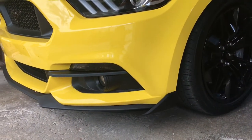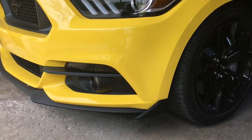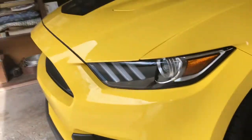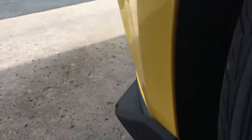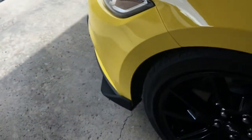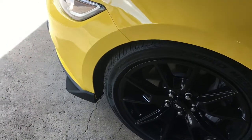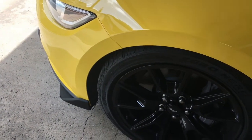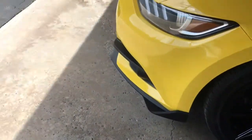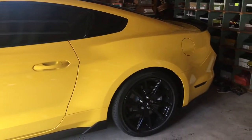The installation was not bad at all. The fog light splitters were probably the most amount of work, but even that was not bad. You take a couple of pins out — there was a pin down here and another pin here — and the inner fender just kind of pulled away, giving you easy access to that screw. You actually have to take the screw out and pull the assembly away, but really it wasn't that bad. And that's gonna do it for the mods on this video.